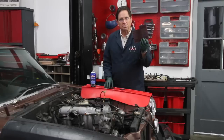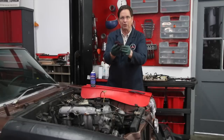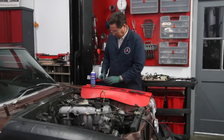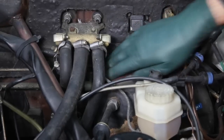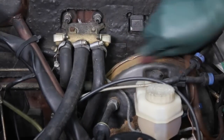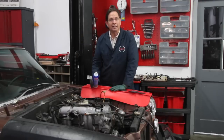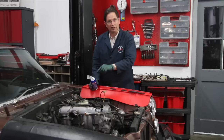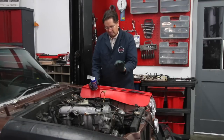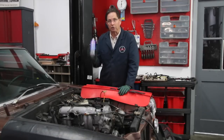I've taken a large purple Scotch-Brite pad and cut it into various sizes to work in and around tight spots. Starting right here on top of the brake booster, I just rub it until I get all the loose scale and rust off — but I'm not rubbing it down to bare metal. These conversion products work best when they can stick to some rust, and you don't want to paint areas that aren't rusty with this. You'll need some small brushes, maybe small acid brushes. I'll go ahead and clean all these rust spots up and then show you how to apply the product.